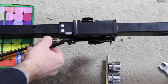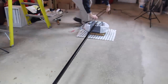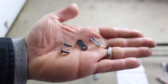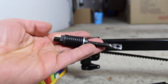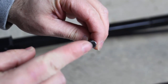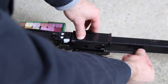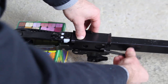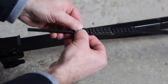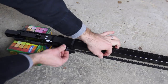Attach the belt to the trolley, and then make sure that the trolley moves smoothly. Feed the belt around the entire garage door opener — around the pulley on the opposite end that's attached to the garage door opener. You'll have this pin system that you need to put in place to connect this spring and this rod. Take the rod out from the spring by unscrewing it. There's a flat side to it that fits into the frame of the trolley, so make sure that that's oriented correctly before you attach this rod to the belt. Put the pin system all together like shown, and make sure that that rod is nice and tight because that's what's going to help pull the belt along the rail system.